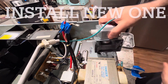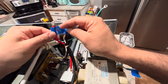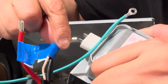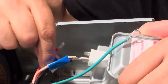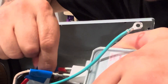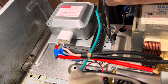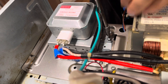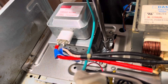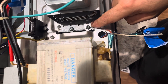That's gonna sit right here just like that. I went ahead and labeled these earlier — red is gonna be your FA, and the black and white-red stripe one is gonna be the F. For the magnetron, I want to get these two bolts on but not cinched down yet, keeping it a little loose because you still have the other two on the other side.